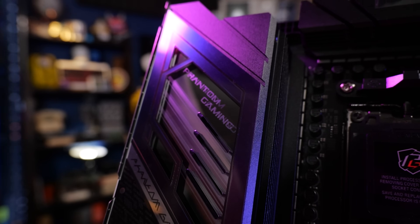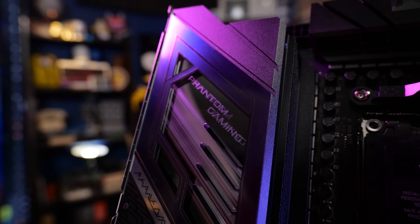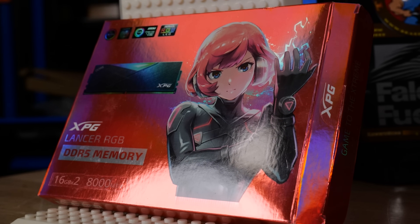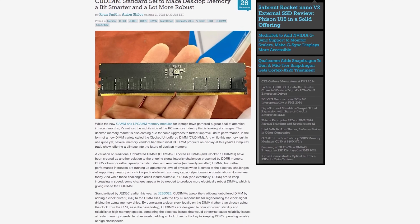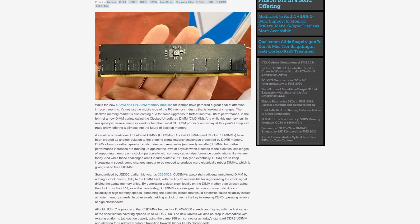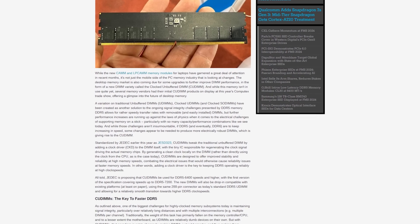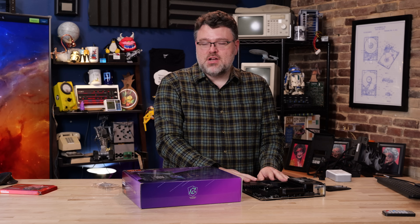Those are basically the same chipset — there have been some very minor improvements, some very minor quality-of-life and board layout improvements. The promise from ASRock and other OEMs is that you'll be able to use fast memory. Like in the title, we have ADATA XPG DDR5 8000 MT/s memory. This is not CUDIMM — CUDIMM is an Intel thing, at least for right now. You don't need CUDIMMs, and in fact you shouldn't buy CUDIMMs, because the AMD platform doesn't use CUDIMM functionality. DDR5 6000 is still the sweet spot — that was true on 7000 series AMD and is still true on 9000 series.